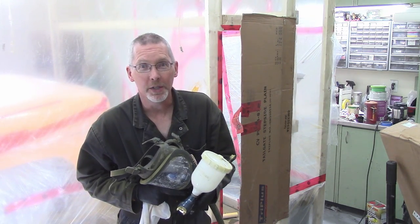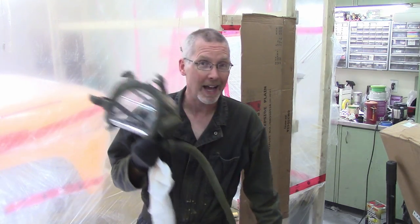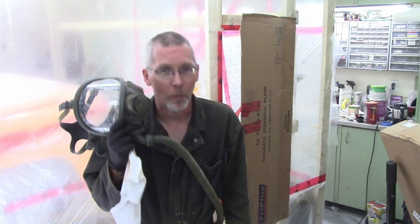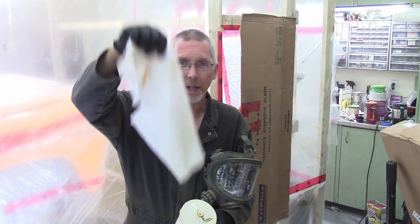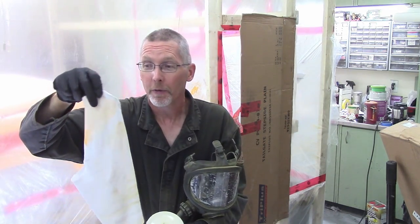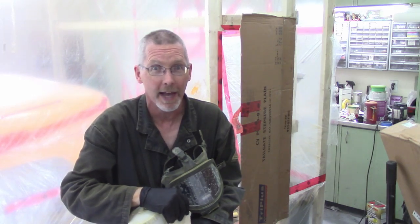This entrance is staged to make it look like I just finished spraying. We should talk about some of the things you're going to want when you're spraying paint on a vehicle. Obviously a gun. However, safety is going to be kind of important — I strongly recommend some kind of a breathable air system or a supplied air system. This was pricey, but wow, it's a whole lot better than a charcoal mask. You want a head sock or a balaclava, not just for late night bank runs, but also because you're going to wear a lot of this paint and the shampoo isn't going to get all of it out. Take your wristwatch off or it's going to be wearing all the colors that you just sprayed. You may want to wear bad clothes.